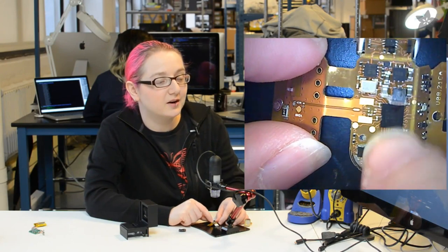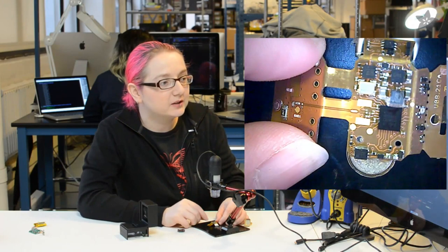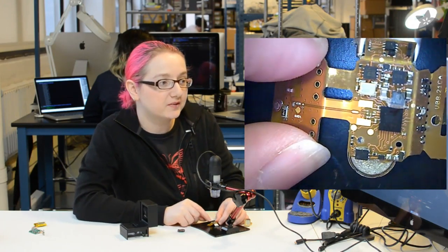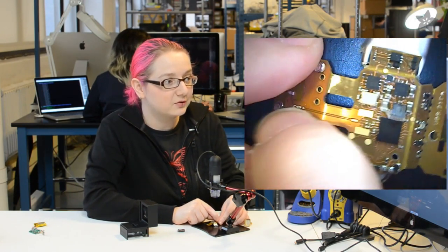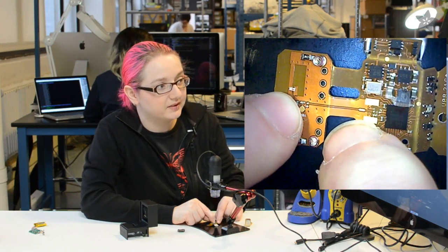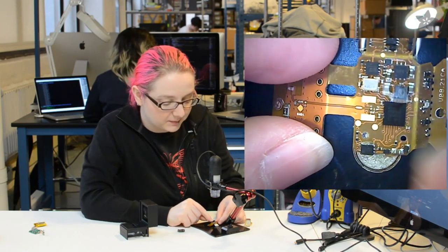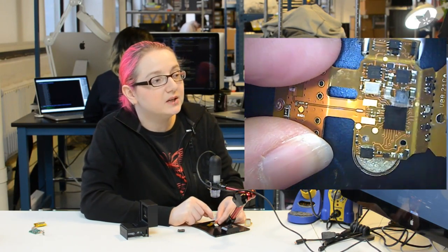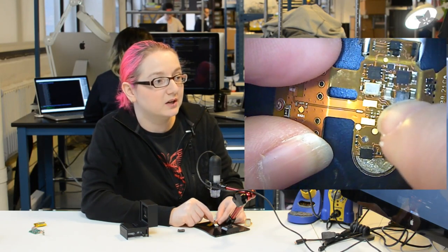In the center is our favorite Bluetooth Low Energy chip, the nRF51822. A great little chip, super low power, comes with a Cortex-M0. So you can do pretty much all the processing you need as well as Bluetooth on one chip. And then you see this cute little antenna strip down here. It goes over to a little microchip antenna on the side, and you can see the strip line as well. And then over here we have a little bit more circuitry. I'm gonna guess that there's an accelerometer probably here, maybe a motor driver chip, one of these, and then a battery protection circuit as well.